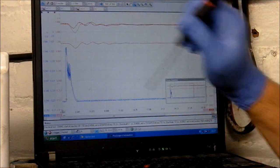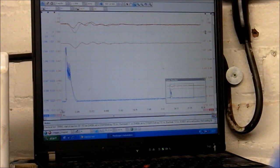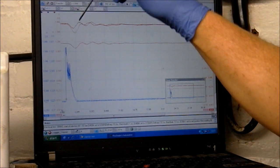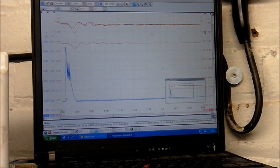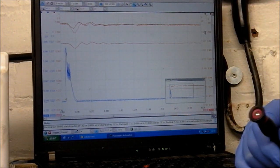That is one millisecond — that's one thousandth of a second. That will be about 2.5 milliseconds. We don't check them anymore, we used to check it all the time. You can see it's opening and closing much too early, so we're seeing that it's looking like the injection timing's out.